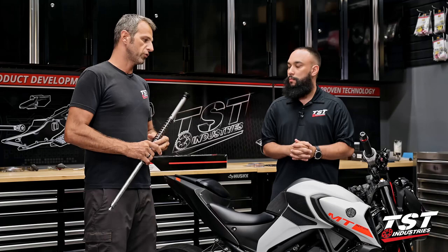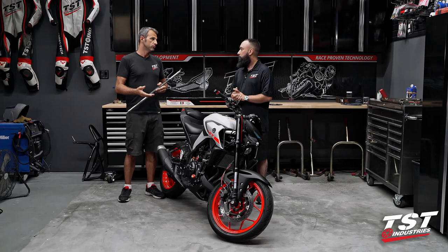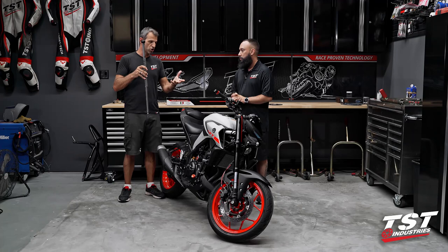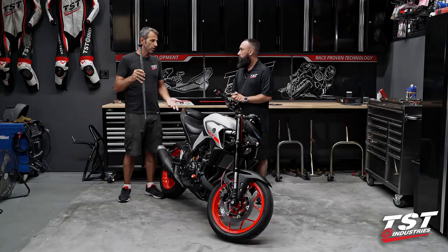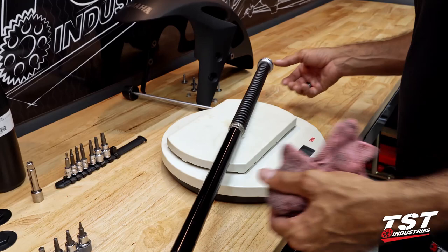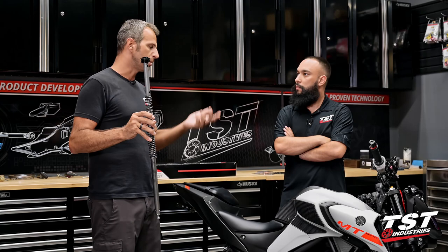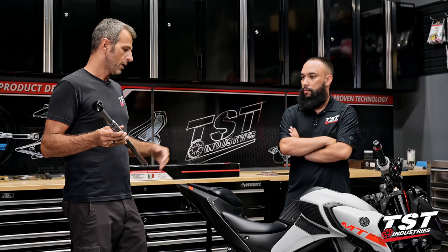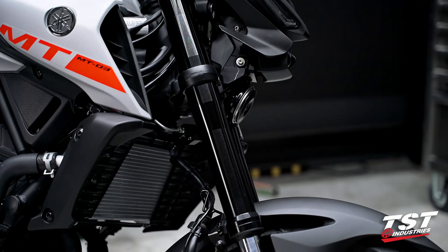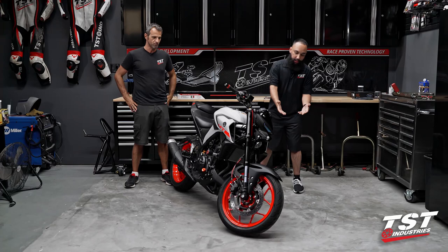You can't really adapt it to your own liking or style. So going with an adjustable shock in the back, we wanted adjustability in the front too. In our race program we've built many bikes with adjustable suspension - that really helps tune the bike to the rider, and if a different rider is on it we can change the tune. Another aspect is taking out these really heavy components and dropping some unsprung mass. On the rebound side we saw a pretty significant change in mass - the net effect was something like a pound overall.